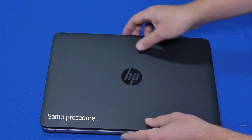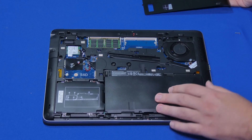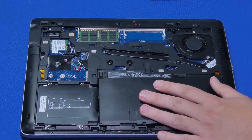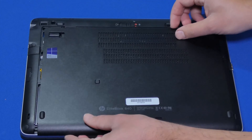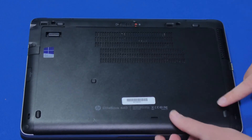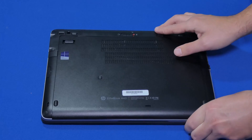So let's have a look at what's on the other side. I can already see the problem — this battery looks really bad, looks swollen up. I'll show you that in a second. The reason I didn't get a chance to show you how to remove the lid is because the lid literally popped off because it was raised by the swollen battery.